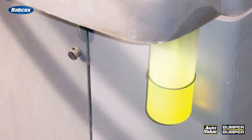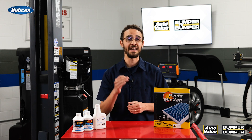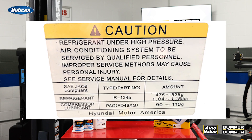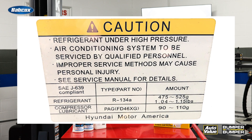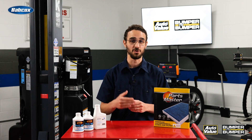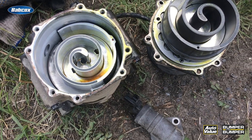It is important to pay attention to the type of oil used in an e-compressor, as it usually differs from the oil used in mechanically driven compressors. There are countless manufacturer TSBs regarding this topic, and high voltage compressors require special polyol ester, or PoE, AC refrigerant oil that is non-conductive. It is extremely important to not use any compressor oil other than what is recommended by the manufacturer. This oil provides high dielectric properties, which helps to maintain the integrity of the compressor's electrical windings and prevent high voltage from bleeding through the compressor itself and possibly electrocuting the technician.